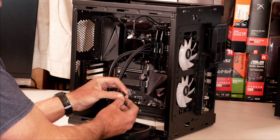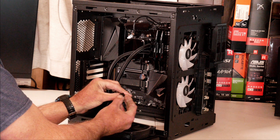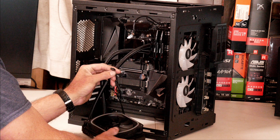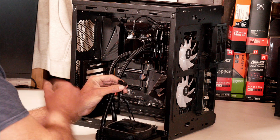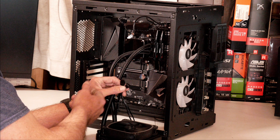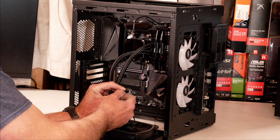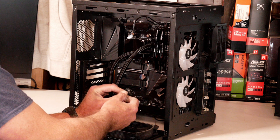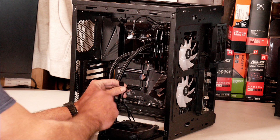As far as the cables on that fan, you do have an RGB lead and also a four pin fan connector, which is PWM. That's something to keep in mind when you do the cabling in your system. Depending on the way your system is set up, you connect the RGB into the other ARGB — it is a standard five volt three pin header. And your four pin PWM fan header will vary from build to build depending on how many fans and splitters you've got and how you want to run the cabling.